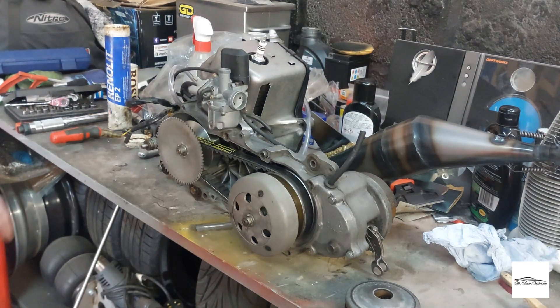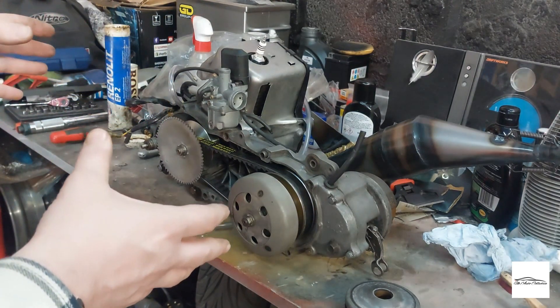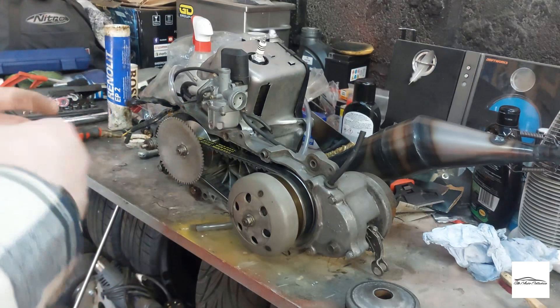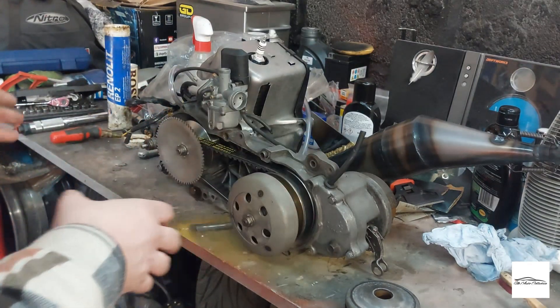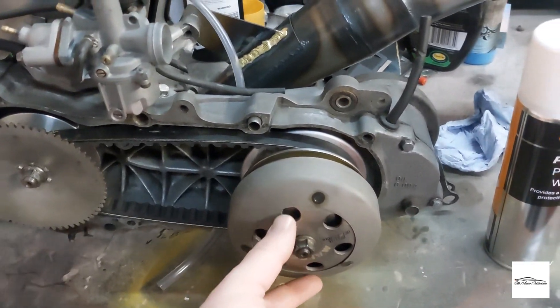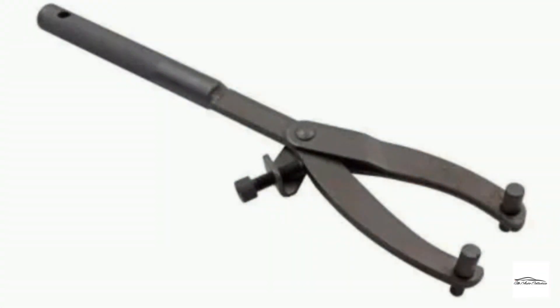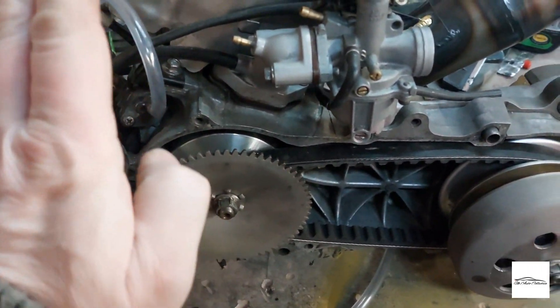One thing I'm interested in doing is drawing a couple of marks on the new variator with a pen. Once I get this running I want to know how far the belt is making up the variator, because that will give you a better top end. That's when you can start making adjustments to the rollers and clutch until you get it absolutely perfect, maximising that surface for better range. I won't be able to torque these nuts up yet as I'm waiting for a universal tool - basically a Y-shaped prong to hold it rigid. One is on order.